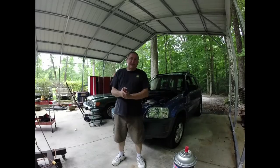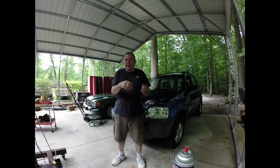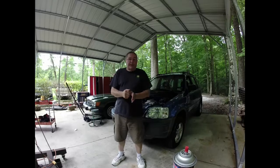I hope you enjoyed the video series on the Blue CR-V — really a pain in the butt, especially towards the end. Once I got the new head on there, things just didn't want to go right. You can only put a timing belt on so many different ways, and every time I did it perfectly and spun the thing, all the marks still lined up after two revolutions, so I thought it was good to go. Unfortunately that wasn't the case, but now it works. Hope you enjoyed it — like, share, subscribe if you like, and I will see you next time.